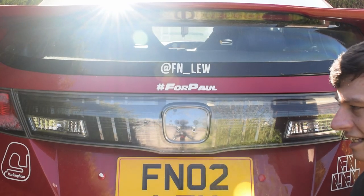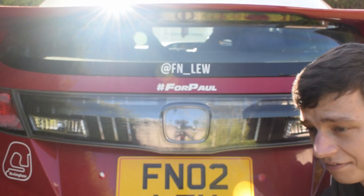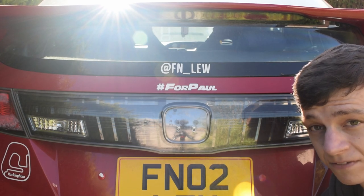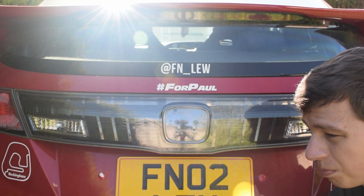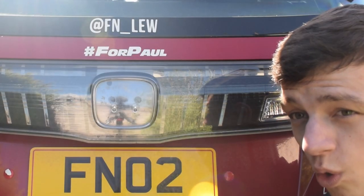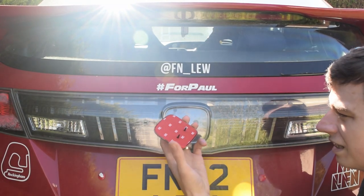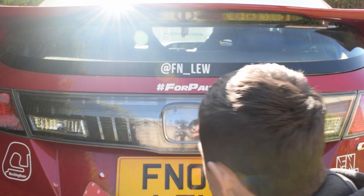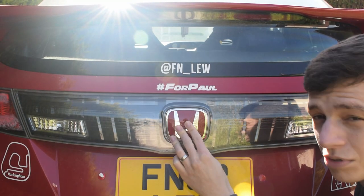I've cleaned all this out. I don't use any quick detailer because that tends to have a water-resistant property that makes your paintwork hydrophobic. I just use normal spray kitchen cleaner — only a couple of dabs and one piece of tissue. I'm going to do a little test fit to make sure it all looks alright. The nibs are too long.